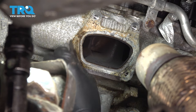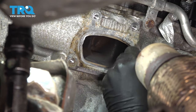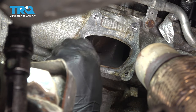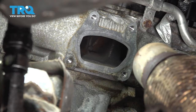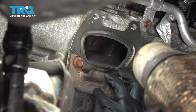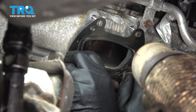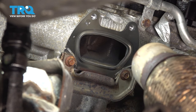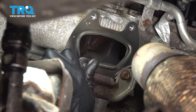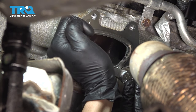Now we have to clean that surface on the head. Take a razor blade and clean the entire surface. Don't sand it down unless you have a sanding block with fine sandpaper, because if you sand it with anything coarse or uneven, it can damage the surface and the exhaust will not seal up anymore. The razor blade will be gentle on the aluminum and will leave a nice flat surface behind. Now with all of that cleaned up, bring the new gasket in with the bracket. You can reach these from underneath and just start them in. The torque for those is only 17 foot-pounds, so when you snug them up, don't go crazy tight.